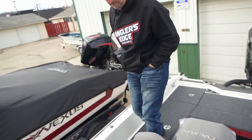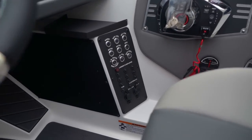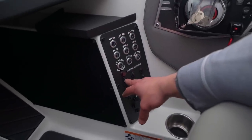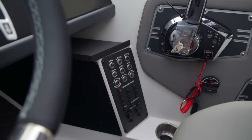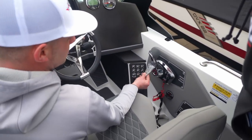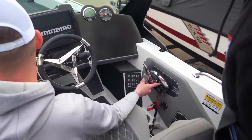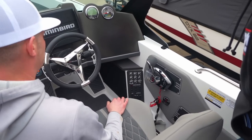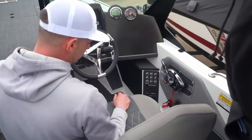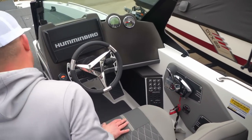Control center — all of our switches have circuit breakers for each circuit, and they correspond with each switch. The horn's there, that's the circuit breaker for that circuit. Nav lights here — just a push-button reset. These are the keys for your compartments in the boat. You can go throttle-only on these motors, but there should never be a necessity to. You should never have to advance the throttle to get the motor to start — if that's happening, it needs to be looked at.